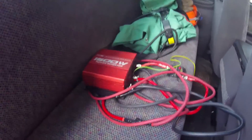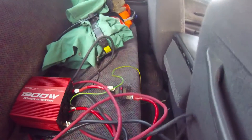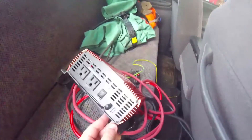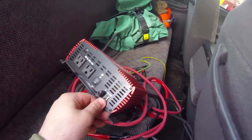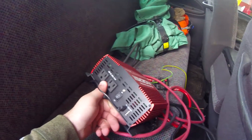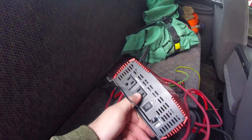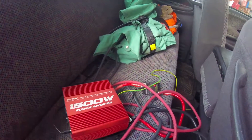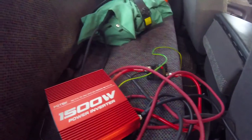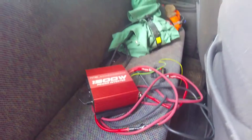I've already had this setup in a vehicle before, so it's already kind of made up. It's pretty simple — you've got a power wire and a ground wire that run to your batteries. The inverter itself has an on/off switch, two USB ports, and two regular 120-volt wall outlets. They were running at twelve and a half amps. Since this is only a 1500 watt inverter you can only run twelve and a half amps, whereas a normal wall plug can generally run up to 20 amps.